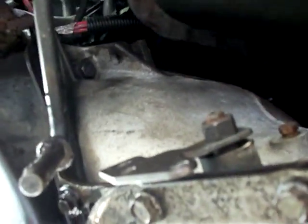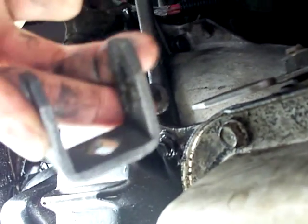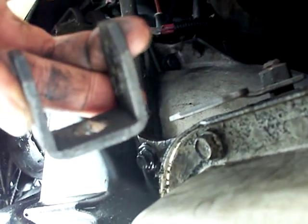Okay, now I'm underneath the car. It said to remove the stock transmission bracket and lever. Here's the stock bracket. Take that off. You take a nut off, and then you install that B&M bracket on it. Fairly simple, as it's got a square hole, so it lines up on the bolt nice.